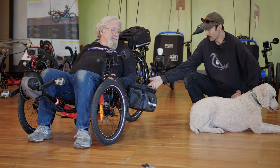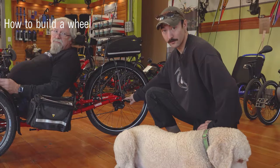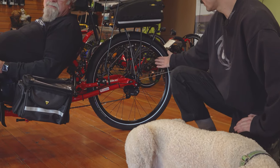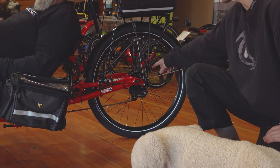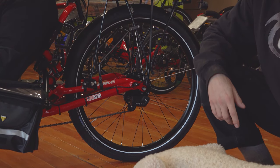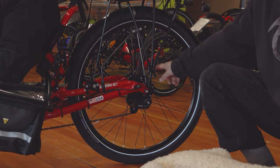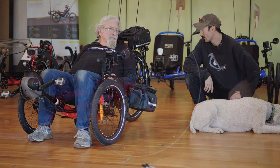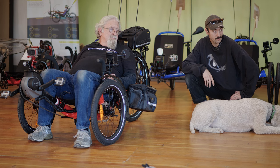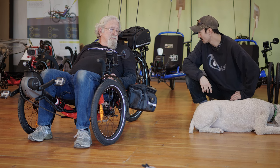In order to build this wheel, after taking measurements per Roloff's instructions on these dropouts, you get your rim, ensure that you have the correct hub drilling to rim drilling spoke count, measure the inner diameter of the rim to the hub flange, cut and thread your spokes, prep them, lace them up — and that was my job.